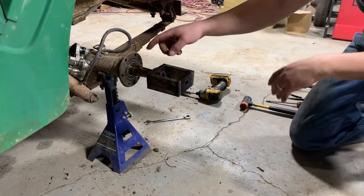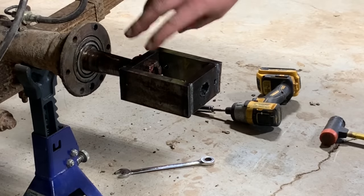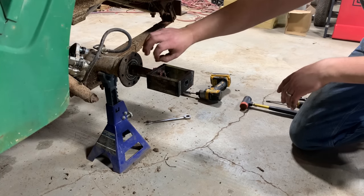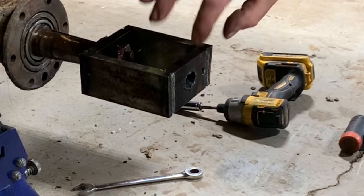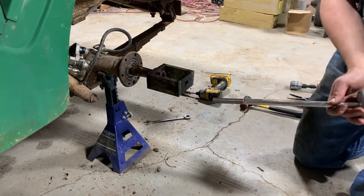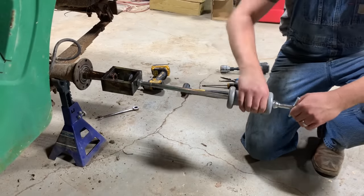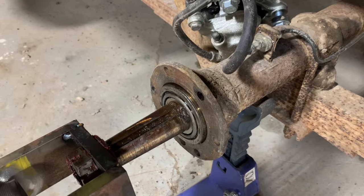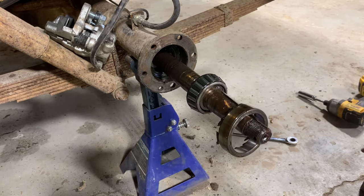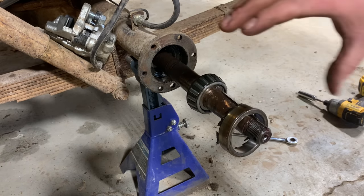You can look up different videos on how to pull these axles — you can pull against this and get the axle to come out. I've had good luck with a slide hammer. I've got this little piece I made up here with a hole big enough to go on the axle. Tighten the nut up as tight as you can, put the washer behind it to protect the keyway, and then put the slide hammer in and hopefully the axle will come loose. Having everything really tight on your puller is the main thing — you want as little slop as possible so as much force as possible goes into pulling the shaft out.